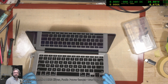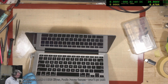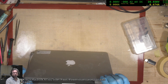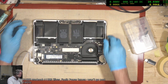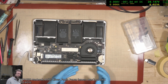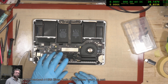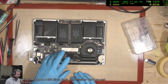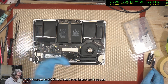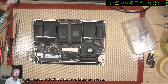Basically, we had an SMC failure with corrosion, which was really good to see because it's a smoking gun fault and it fits with what the customer was experiencing — it was just running like a sad sack of potatoes. Because I didn't want to source a genuine 4924 board, and I know I've got plenty of the earlier boards, I took the SMC from an earlier board knowing it would still boot on this board, then put the SMC reflash on it. Now we have a 4924 SMC without actually having had a 4924 board — so that worked out well.